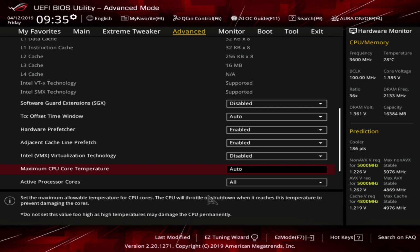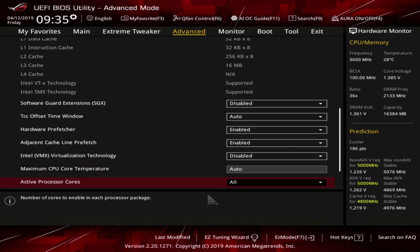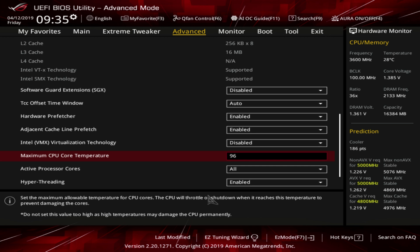Or potentially even lower it, if you're running very intensive workloads at very high voltages. Generally lower temperatures means the CPU lives longer because it reduces your CPU's leakage, and there are lots of thermally driven effects within the CPU that improve CPU lifespan as the CPU gets colder. So yeah, that's kind of that. You can tweak that. And where does that actually bottom out? I guess it's 0. Oh no, there's a reasonable bottom.